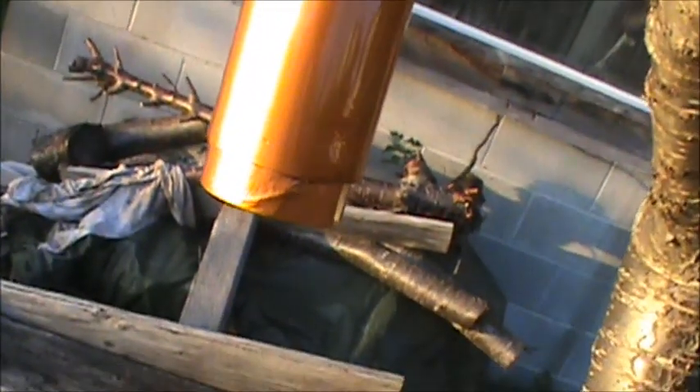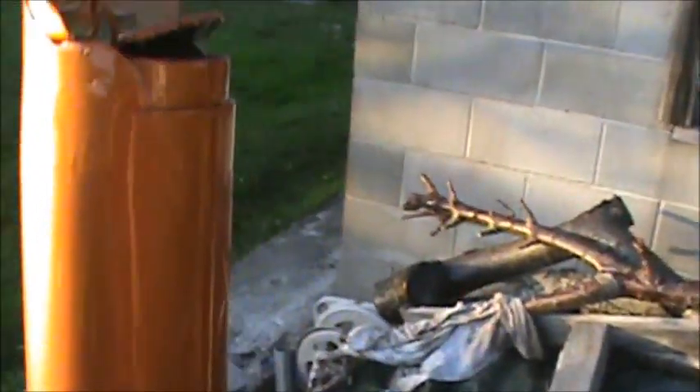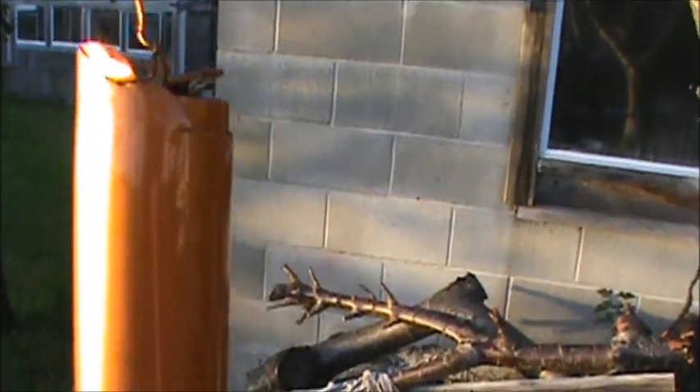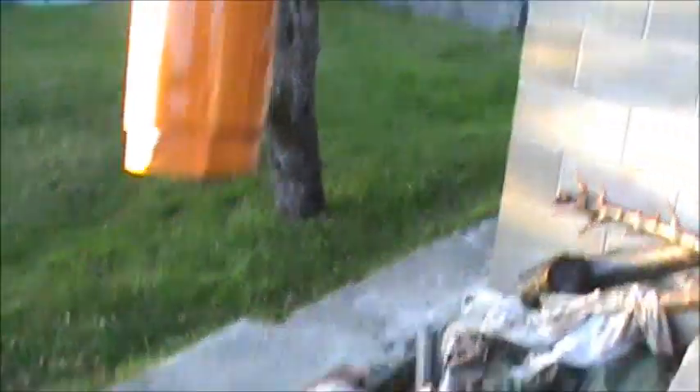There — it's painted. All I gotta do now is just unmask the pieces in there. There's a piece of masking tape on this collar here. What I did — I made the collar narrower, as you can see, so you can slide this into an existing exhaust. If you want to drill one hole or two holes into the exhaust, then plug-weld this to the existing exhaust pipe. It's painted the same color as that one.